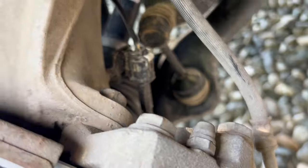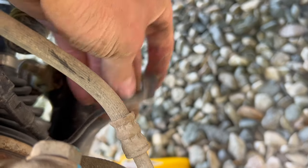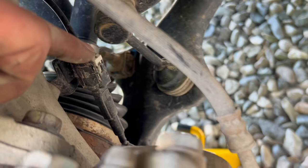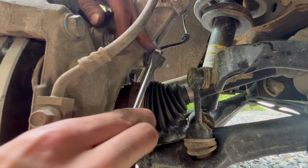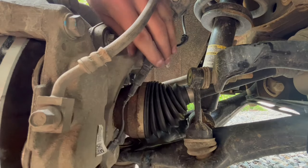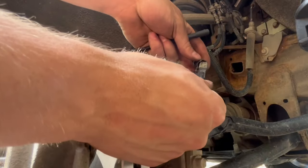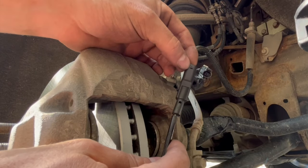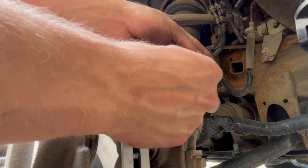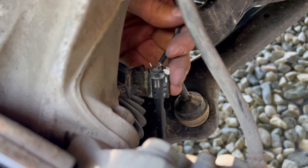Your new kit should come with a new brake pad sensor as well, so that when you're in your vehicle you can check exactly how much is left on your brake. Your new kit comes with a new one, so all we're going to do is disconnect the old one and hook it up to the new brake pads. This clip will just push back — be careful, these break really easily. Once you have that done, you can reach in and that will release the bottom piece. You're able to reach in there, pull up on it, and get it out. Put your new one in there, making sure this little ridge is facing up, and just push in until it clicks. Once you hear that click, you are in place. Make sure to put the clip back onto the bracket.